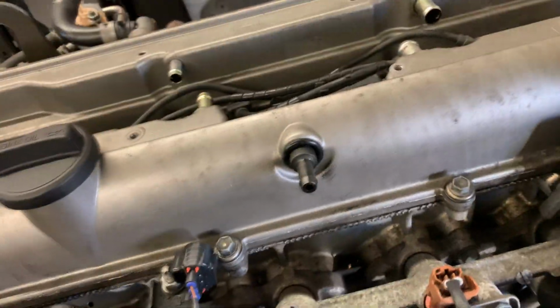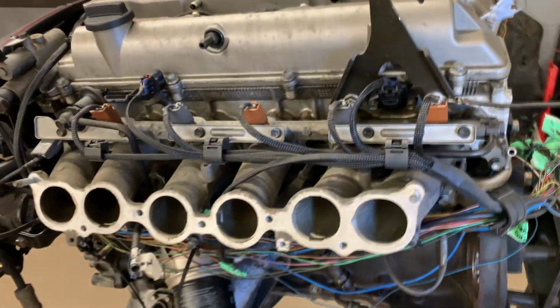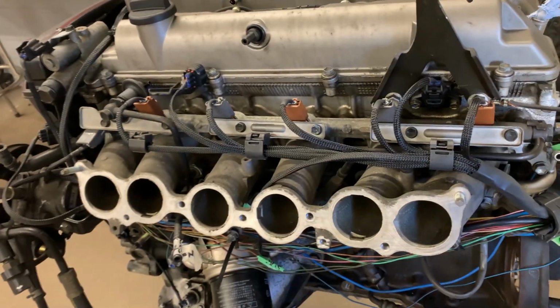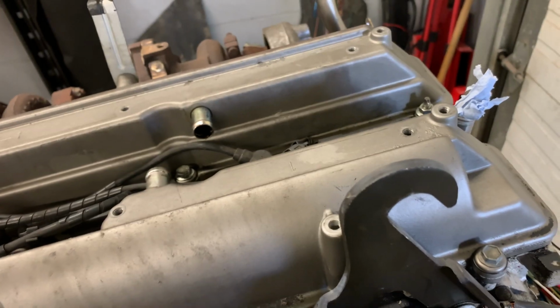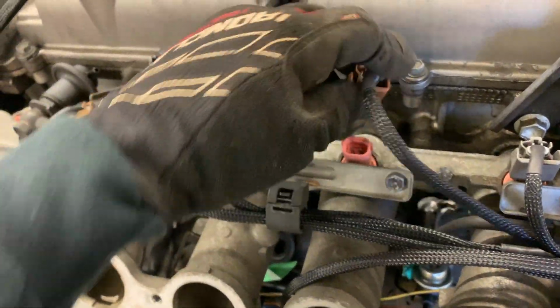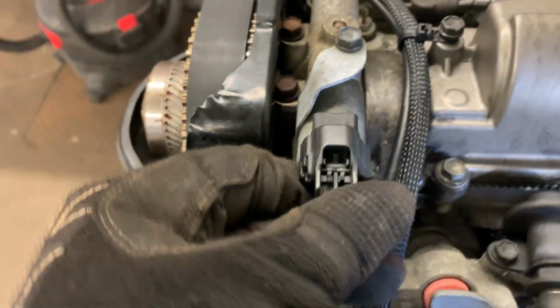And I also completely forgot that when I ordered my ECUMaster, I ordered 2.85 meter leads, like actual marked wiring. So I've done this two times, and I'm gonna do it a third time when my wiring comes in. And I also ordered all brand new connectors from Wiring Specialties, because as you can see for this one, there is no lock anymore, because as soon as you touch them they literally just break. And the injector ones are even worse.